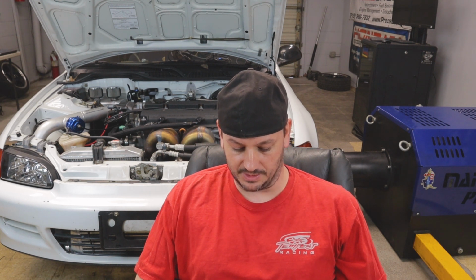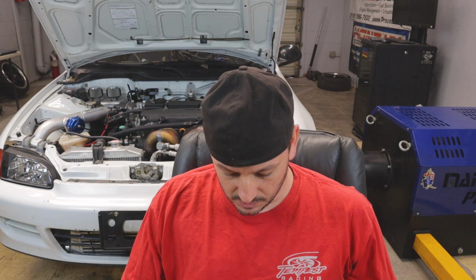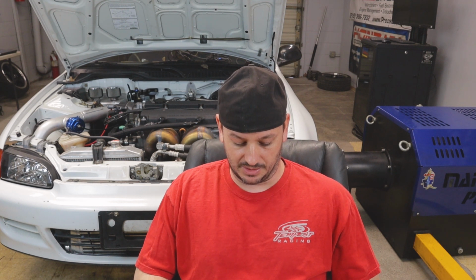Why do you point fans at the dyno? So I did a few videos that appeared to have carpet style fans pointing at the dyno. They weren't pointing at the dyno at all. One of them was a Dodge Viper where the exhaust came out right before the rear wheels, and it was on methanol, so I would just use some carpet fans to help push some of the fumes outside. We've never had any type of heat issues with the dyno, even running multi-thousand horsepower cars for 8 to 10 hours at a time. You can feel a little heat coming off of the dyno, but nothing that prevents it from working. And there are internal monitors and warnings if it were to get too high.